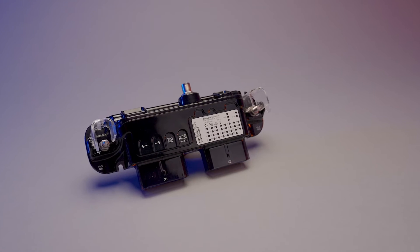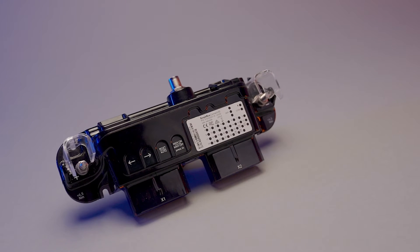The Kinect 50 has a 100-amp total capacity and each output channel has a 10-amp limit. It's a digital switching unit with inputs and outputs. If you need more than 10 amps on any circuit, you'll need to use an external relay to control that device.